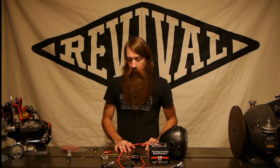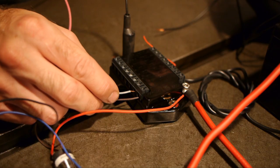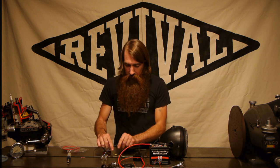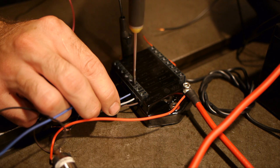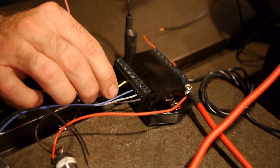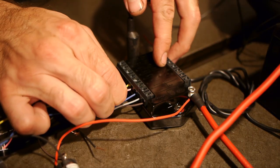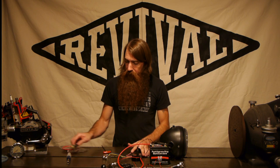Let's start with the brake light switch — this gets installed into the brake light input, and tighten that terminal. Then let's add a headlight switch using this blue wire run to the bar controls. Then let's add the turn signal button — that's the yellow wire — running to the left hand turn signal input. And then we're going to need a configuration button, which goes on the red terminal.